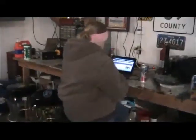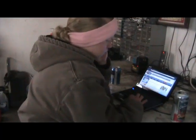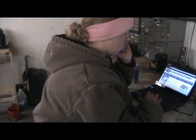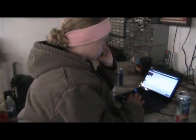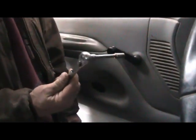So I can get the lovely Kayla — Vanna White — to be my camera woman for a moment, and we'll show you guys how to put these door handles in. Pretty easy. Just got to have an eight millimeter short extension, medium extension, and a quarter inch drive ratchet.